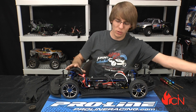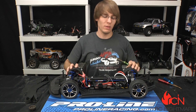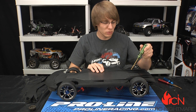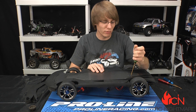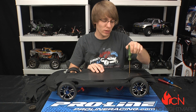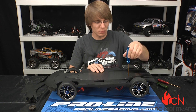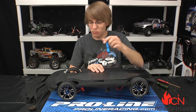First thing, body's got to go. We want to look at hardware — basically everything. Just grab your wrenches and start looking at any piece of hardware you can see in this thing. All the pieces of hardware on the bottom — I'm going to check all these to make sure they're tight. Just grab your wrench, stick it in there, and start checking them. Hand checks are better than anything. You never know if one has worked its way loose, and they will over time. You don't know if from the factory it just didn't get tightened down all the way, so it's a good idea to run through all these screws individually.